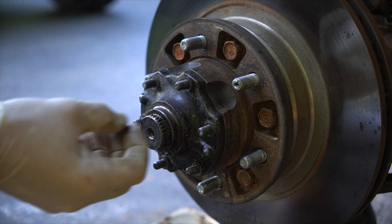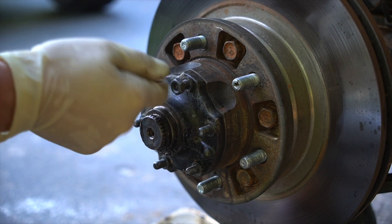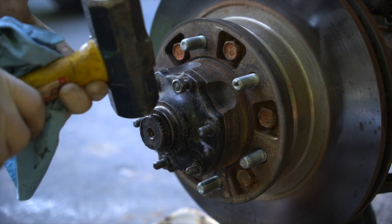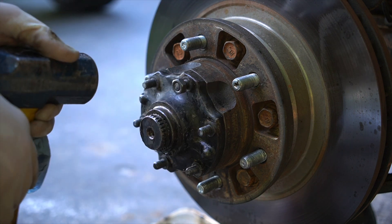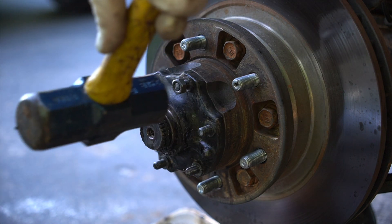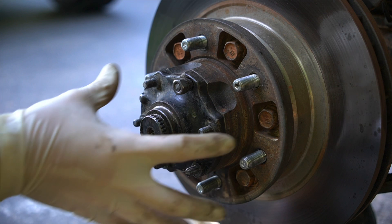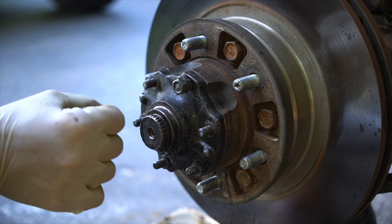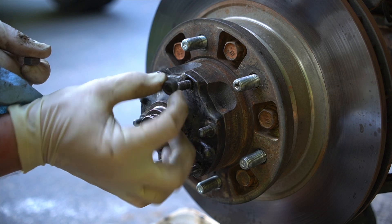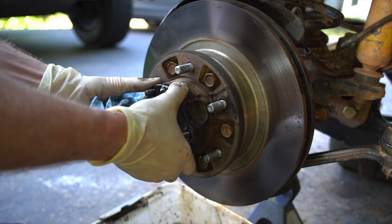Be careful not to bend one of the studs. There's a tapered cone washer that seats into the flange. The best method to get these out — screw one of your nuts on until it's flush with your studs so you don't mangle it, then take a hammer — I'd actually recommend a brass hammer, not quite this heavy — and give it nice light taps. Eventually you'll see the cone washer start to work its way out towards you. If any are stuck, soak them with penetrant and heat slightly with a propane torch. With all cone washers out, it's as simple as pulling your flange off.